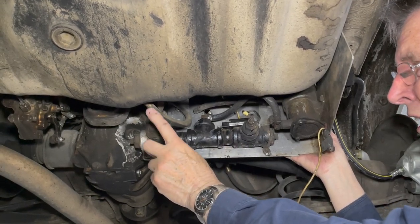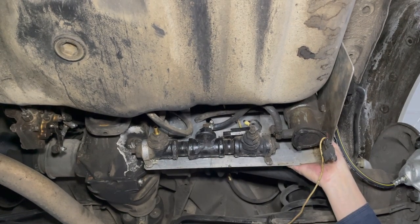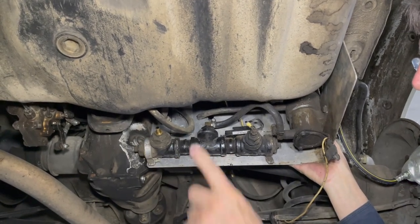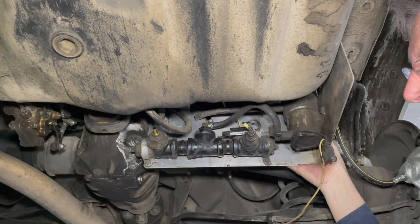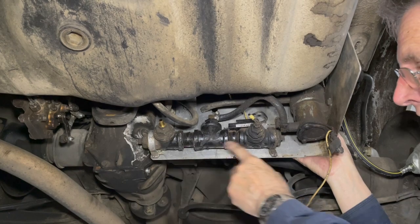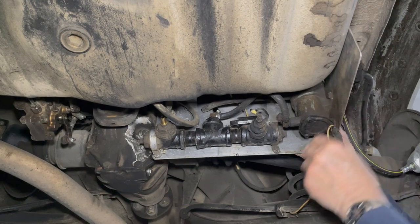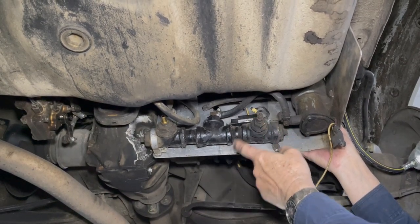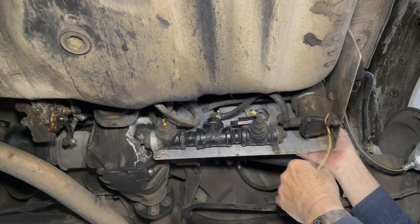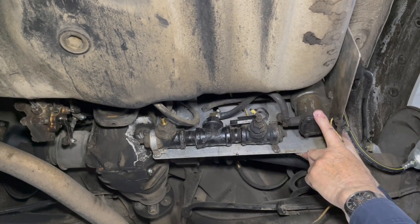I only need about two or three inches of hose. If you get into a situation where you have extremely cold weather and your straight vegetable oil starts to congeal, I recommend you add about 20% diesel fuel to the vegetable oil — that will allow the fuel to flow out and get into this heated sump during those cold weather periods. If you install something like this, you'll need to run electrical wire back here to heat the sump glow plug and to run the electric fuel pump, which is controlled by a switch panel on the dash.